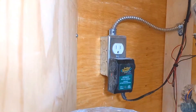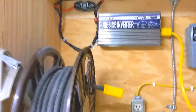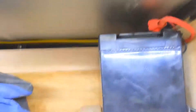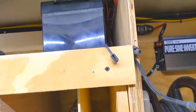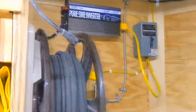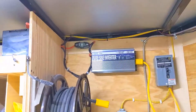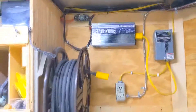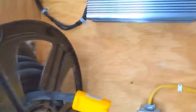The way this is going to work right now: I've got this battery tender, which of course I'm running off battery power so it's not charging anything right now. When the trailer is plugged up to shore power, it will charge the battery. The battery is sitting over here for now — I just put a couple of scrap pieces of wood in to hold it. When I'm plugged up to shore power, I'll come and connect this lead and the battery tender will keep the battery charged. If that works out, I may not even add the solar panel, because honestly it's about a $400 expense — around $300 for the panel and the charge controller I want.